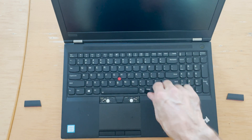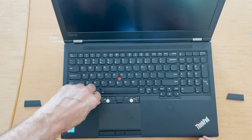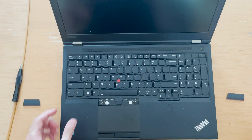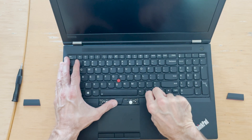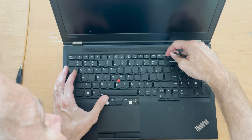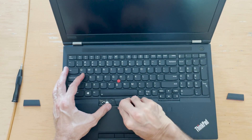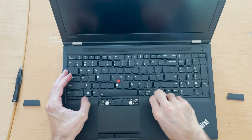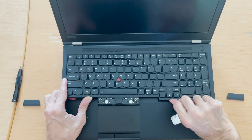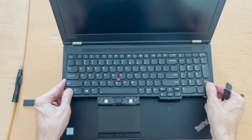Then there is the screw — it's a Phillips — and it doesn't come all the way out. When you hear it click, click, click, it means it's already spinning free. Remove this one. I'll use my left hand so I don't block the camera. It's sticky, so I have to pull that way until the gap closes and the keys are flush with the bezel. There — I pushed it and you can see it closed the gap. Once it closes, the tabs come out and that's when you slide it.